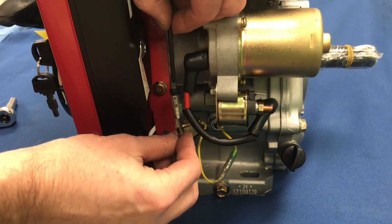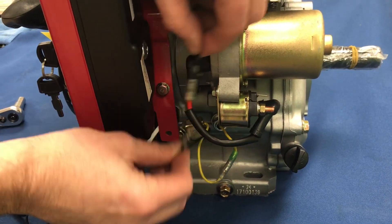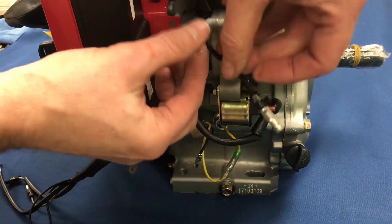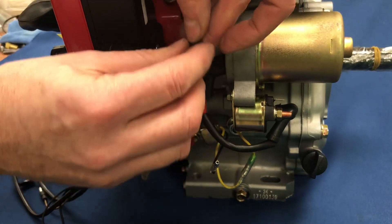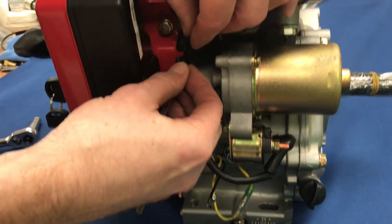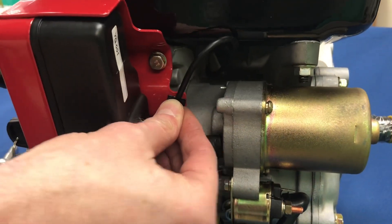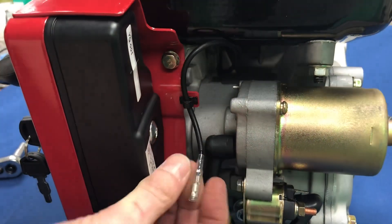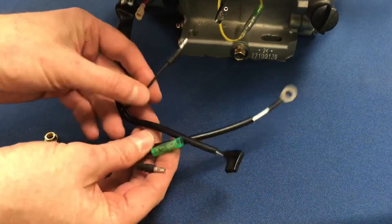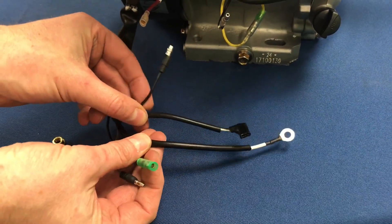Find this pre-attached black wire here and just disconnect those two. Then midway down, on the top portion, there's a little black clip — press this clip up into that hole on the back of the electric start, and that holds that wire in place nicely.